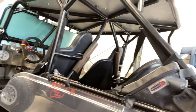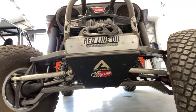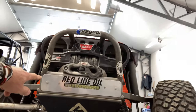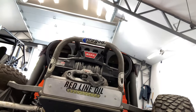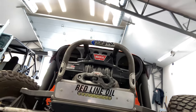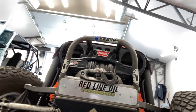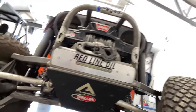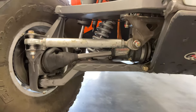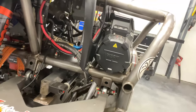Let me show you a little detail on the buggy. Starting in the front — it's an IFS car. We designed it back in 2014 after we'd already built our first one. It's got the minimal amount of things — literally down to like one Rigid single-row light in the front, because King of the Hammers is a day race. It's got 30-series CVs, Alcon brakes that are just massive, and a 7-inch throw rack. This power steering cooler from CNR Racing is so efficient it doesn't need a fan behind it — just transfer airflow through that thing keeps our temps. The max this thing's ever hit is 210 degrees, which on power steering fluid is fine.